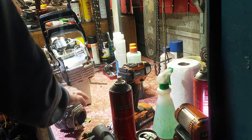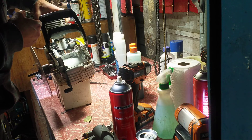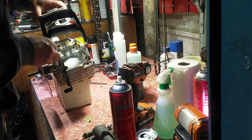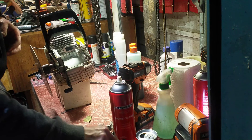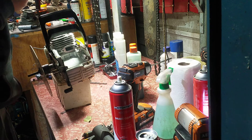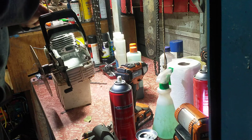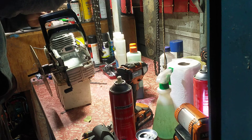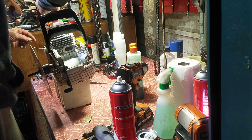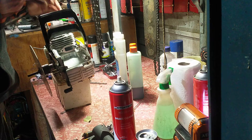Put this cylinder back over where it's meant to be. I've already lubed up inside the cylinder with finger and oil, just so it's all lubed now. All the high spots have been taken off so it should slide in and out — no scratching, no nothing, no rings at the moment. I'll get two bolts and nip them up. That's probably strange slang — the Canadians call it cinch, or titch it up — but just slightly torque them up.